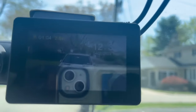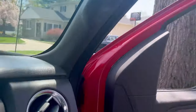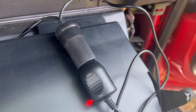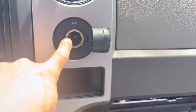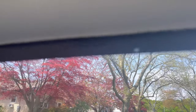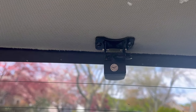So I wired the camera. It's on top there, into the A-pillar top, down to here where I've connected an internal battery power source to a cigarette lighter extension, because I don't want it to hang here with wires. Through the A-pillars, the back camera is routed through the top moldings — right there. So now this camera is pointed backwards.